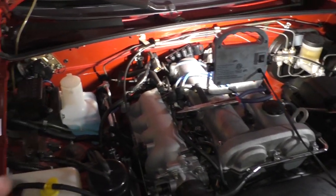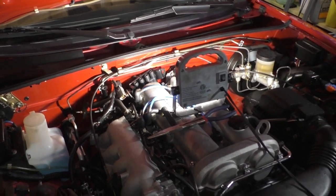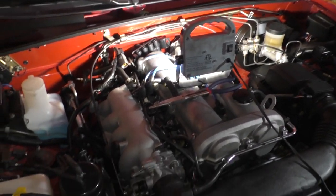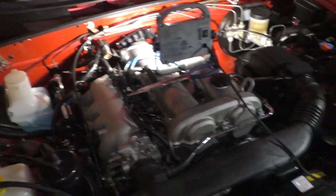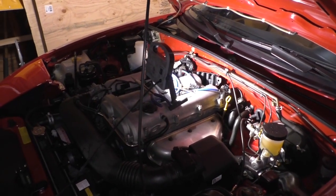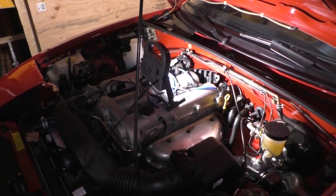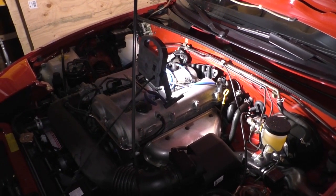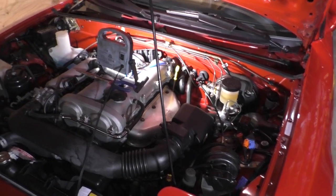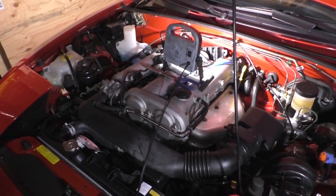If I had left it that way, this is where things can go wrong. Eventually the sensor, or the gauge, would burn out from overheating. Don't let that happen. If the wire was severed or cut, the gauge would flatline. It would do nothing. So when I put it back together and start the car up, if the gauge does nothing, then we know for a fact that the wire is cut. But I'm going to check the wire for any obvious damage and make repairs if needed.